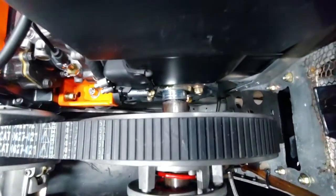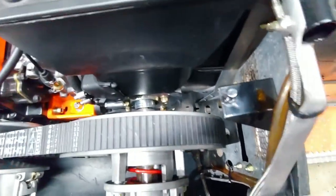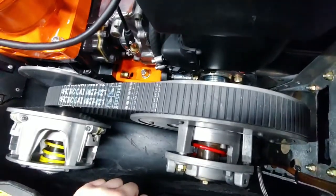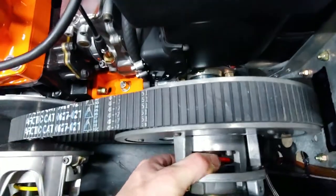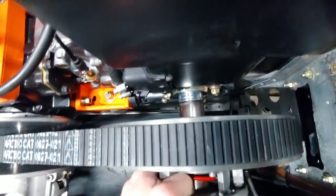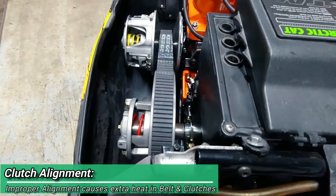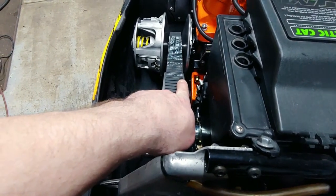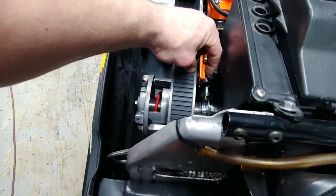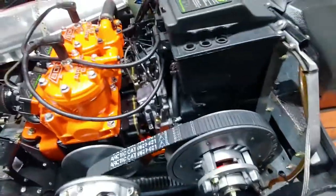I mean, gosh, I put like 8 spacers in there. Those are machine bushings. If they didn't have any of those in there, and I had to put washers here as well. It's to take up the space, because it's supposed to be able to move an eighth of an inch back and forth. Well, this thing was offset so bad. It was over here, to the right. Oh gosh, a half inch. It was unbelievable. I couldn't believe it. So yeah, that's all lined up.